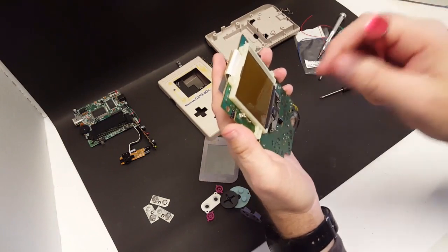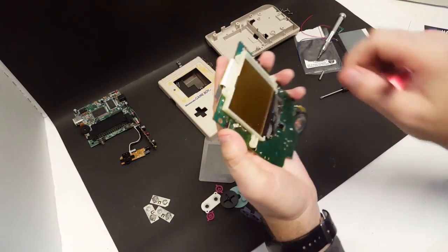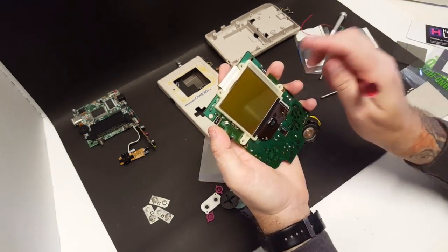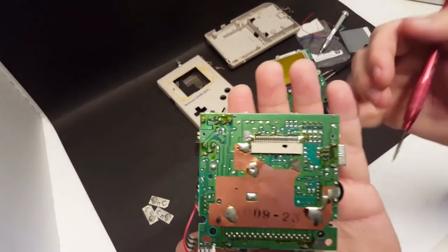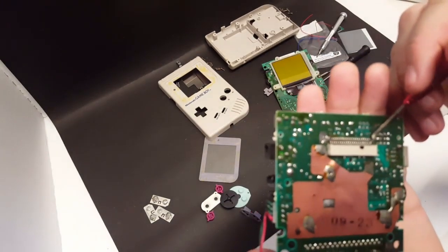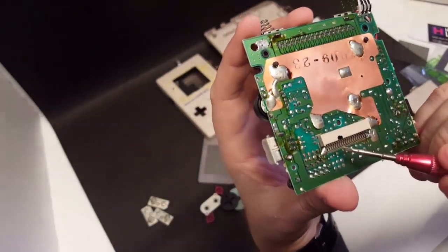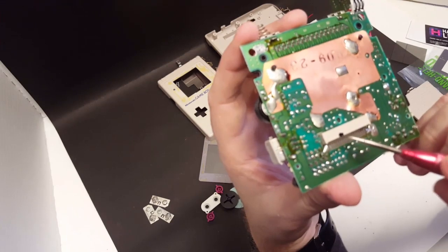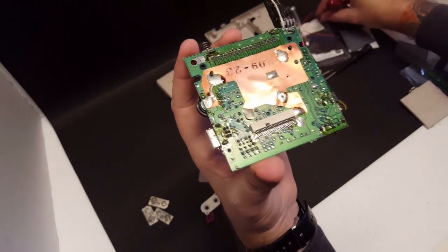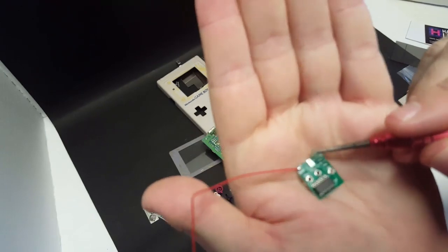And then we'll need to take a razor blade and remove the reflective film and the polarizer film all in one pull. That's going to be the most difficult part about this entire operation. The rest is pretty simple. The bivert chip is going to go on this side, and we will need to bring up pins 6 and 7 on the connector here. So we'll just count over to 6 and 7. We're going to run some flux on that, heat those up, and pry those off. And then on the bivert chip itself, pins 6 and 7 will actually sit right here.